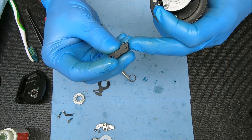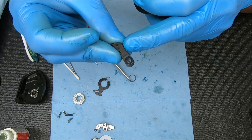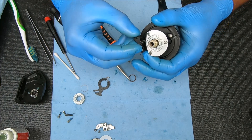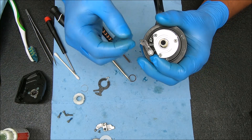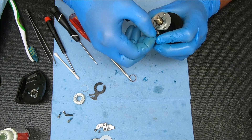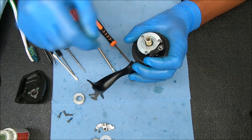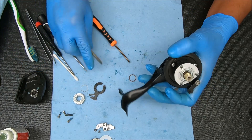That little point there will be facing up so that piece can go around it. That spring needs to fit inside that little slot right there on the arm. You don't want to go too low because there's a post on the bottom that needs to go over this ridge, so it stays in the area it needs to be. Get it over first, then drop it in place so it's secure. Make sure that spring fits inside the slot — now we can see it works properly, it doesn't flail out. Take our E-clip and put that back on there, using the flattest screwdriver — put it on top for support and push it over. Make sure it's on there and now we're good.